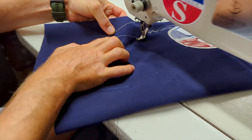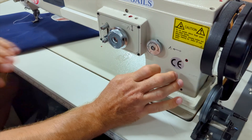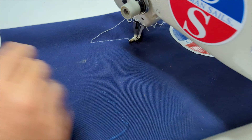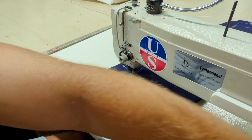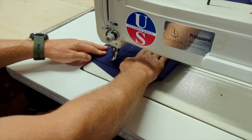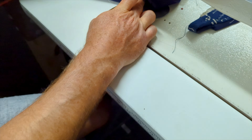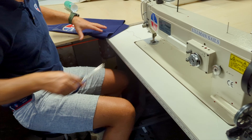Sewing well — the threads are really close together. I'm going to open that up just here. And then you want to look on the back side to see your bobbin tension — you can see there's no looping or anything. It's pulled nice and tight, so we're happy with the tension. Now we know the machine's ready, and it's ready for Bill to do this repair.